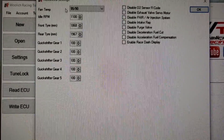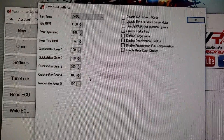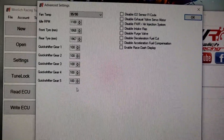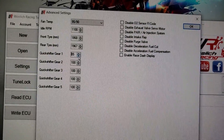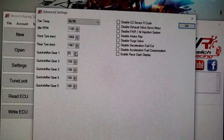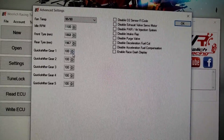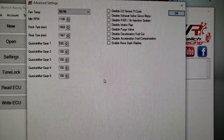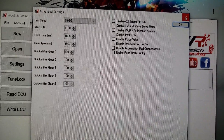This is $260 just to be able to use this, and it's per ECU typically. If you pop into advanced settings, gears 1, 2, 3, 4, and 5 - these are actually the shifts that you would have to control the quick shifter if you weren't using race tools. This is a measurement in voltage, as I've been told by Archer, by Justin, etc. By reducing this you're reducing voltage. People get this confused and think it's actually milliseconds - 60 is not in milliseconds. This is a completely made-up number, so you just kind of have to guess and figure out what works.